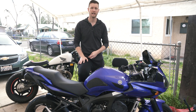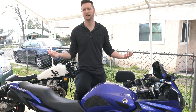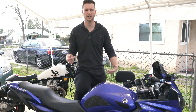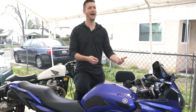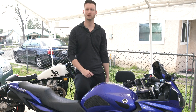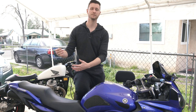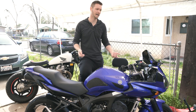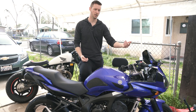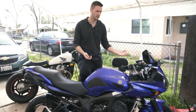That's the diagnostic mode on the Yamaha FZ6 — again, this is an '07 FZ6 S2 model. This also works for any of these gauge clusters on the FZ1 as well. When I got the code I had no clue what to do, and people on the forums were just guessing without knowing how to enter diagnostic mode. Using the codes and diagnostics in the owner's manual, you can troubleshoot pretty much any electrical failure in the bike with no guesswork. Code 19 could be a side stand switch or a failure in the starter switch, and the diagnostic narrows it right down.